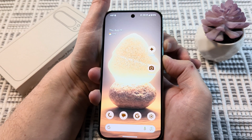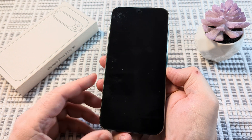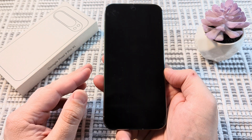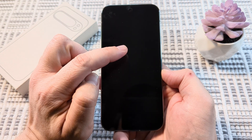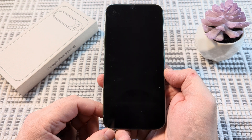Don't let go — just continue to hold that. What's going to happen is it's going to turn off and reboot. You might think you need to press some buttons to trigger the reboot, but you don't. It just takes another 10 to 15 seconds, and then you wait until you see the Google logo pop up — that's when you know you've hard reset your device.